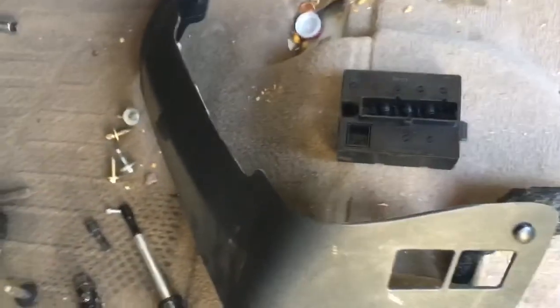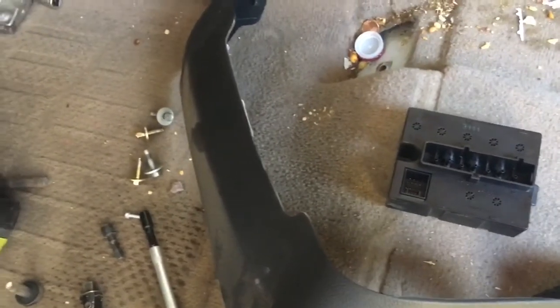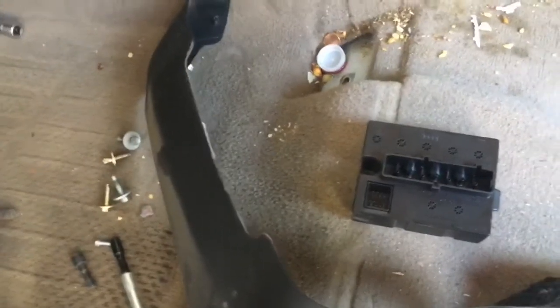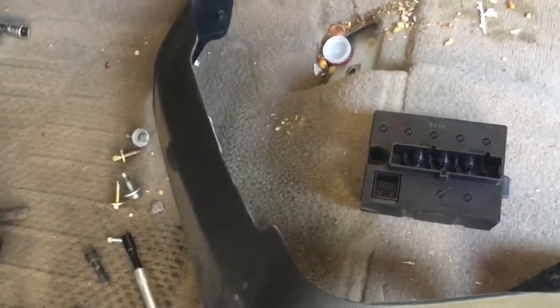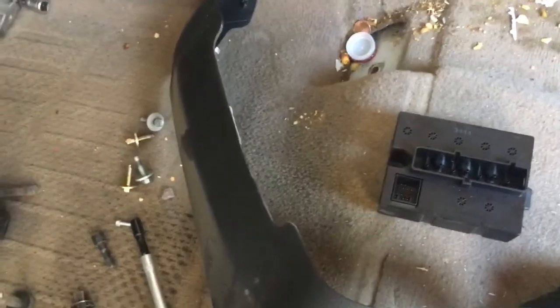One other thing to consider is when I bought this truck, it was clear that at one point in time a battery exploded underneath there. So there are a handful of battery vacuum lines that had battery acid all over them, and I replaced a lot of those too. So if you're having vacuum issues, that back corner behind the battery is where you need to start. That solenoid for the hubs is a big culprit, and then just follow it out from there.